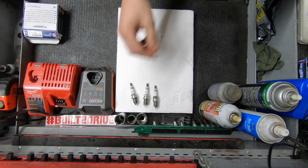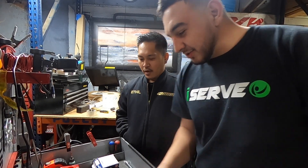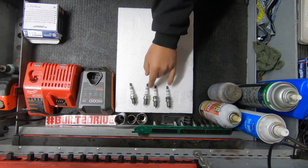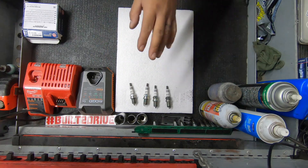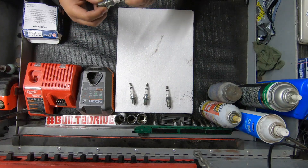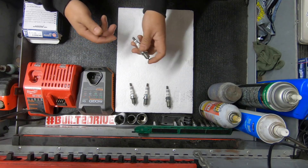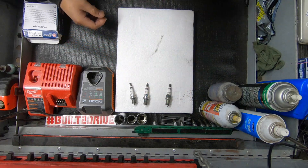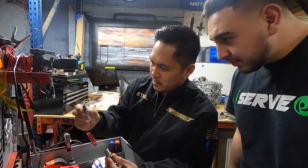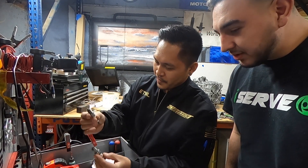My reasoning is the coloration — these look like more of a shiny metal, and this one looks more heat treated. I could be wrong though. Technically you actually are wrong, but it's okay. It's easy to judge by color, but these are not the case. I'll show you: this is clearly a knockoff. One telltale sign — see how the ground electrode is a straight 90°? This one has a nice arch, a little radius to it. This is the legit one.